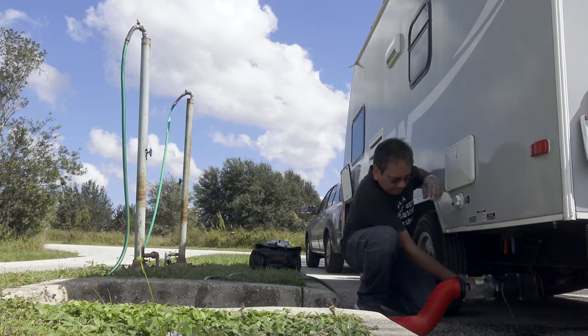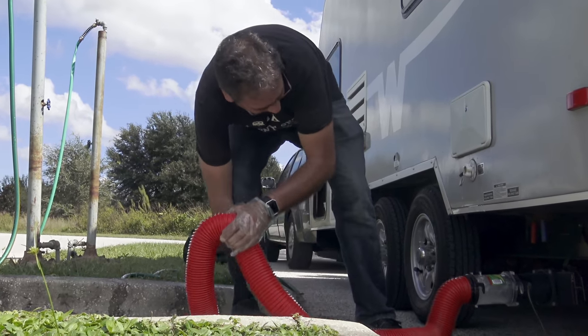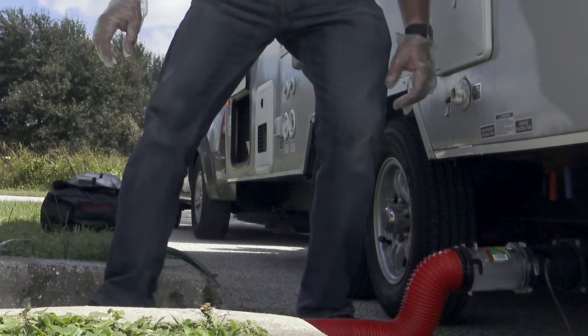One of them is a clear sewer elbow, and that should have gone with the extension sewer hose — all the sewer hose together. You need an elbow, and you need something clear to see what's coming out of your black water tank. In my case, I have a straight because my sewer outlet is very, very low to the ground. If I add an elbow, making it even lower, you almost have no incline for gravity to do its thing. Another place to put the elbow is right by the sewer hole on the ground. But yeah, if not an elbow, at least a straight, so you can see what's coming out of your black water tank and know when it's relatively clean when you're flushing.